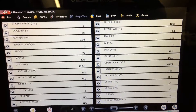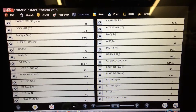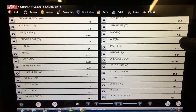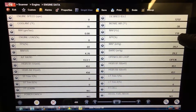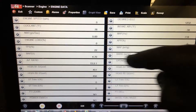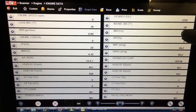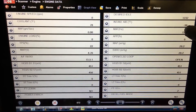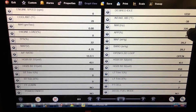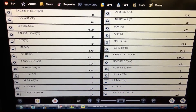I have repaired and replaced the wire — a little bit of wiring to the reference ground on the mass air sensor. With the car not even started but the key on, I am getting over 700 hertz at the MAF signal. I'm not getting any grams per second yet since I haven't started the car. The problem is still with the intake air — it is still at negative 38 degrees, meaning the intake sensor is still not registering anything. But one problem is now fixed.